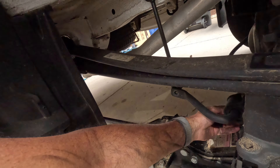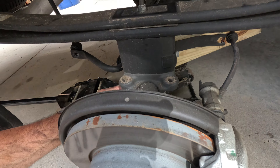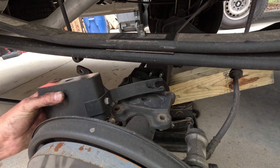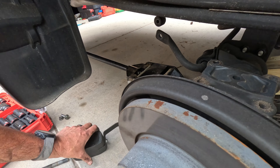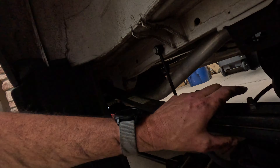When you lower things, you just want to make sure there's no tension on anything — there's a bunch of stuff that runs through there. We're going to take some clamps and actually clamp this spring together because we don't want it to move. You can see the block is loose — it has an indexing pin. Now we just remove that block, clamp the leafs together so they don't separate, and then remove the bolt.